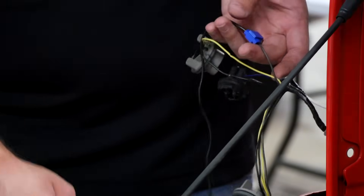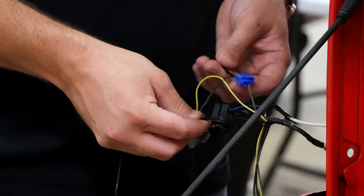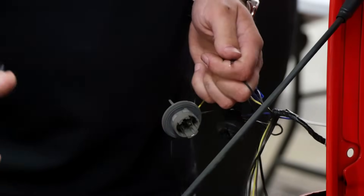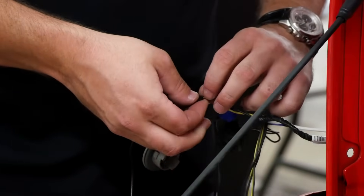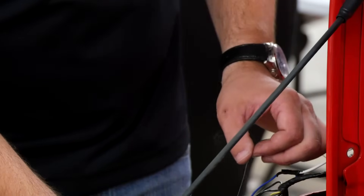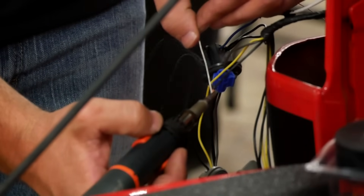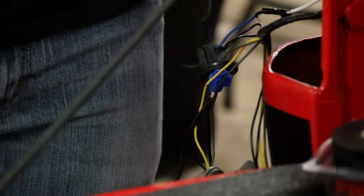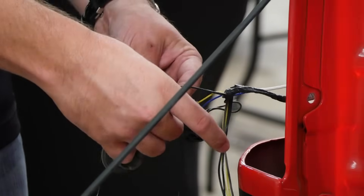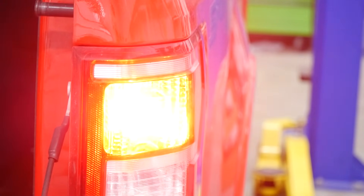Now if you want to solder it, we need to connect the other end of our resistor to the ground wire. Remember: one end of the resistor goes to the turn signal wire, the other end goes to the ground wire. Use a wire stripper to strip the resistor wire back a little bit, attach it to your ground, then take your soldering iron and solder the two wires together. Next, we've got this bare connection here — the last thing to do is put some good electrical tape over it. If you had a bulb in this socket with the resistor wired properly and you had fast blink before, you won't anymore. It'll slow down; the resistor will start doing its job.